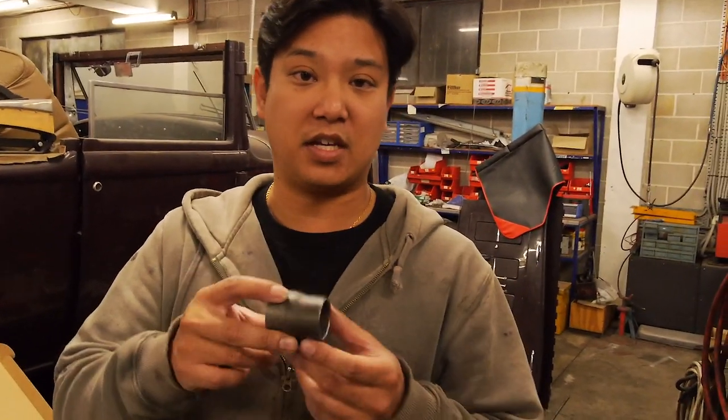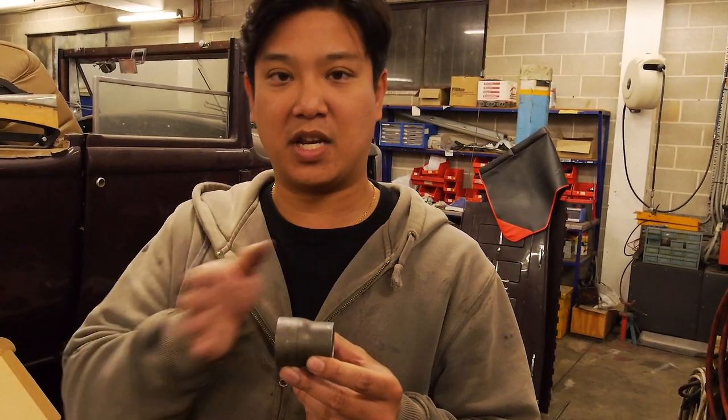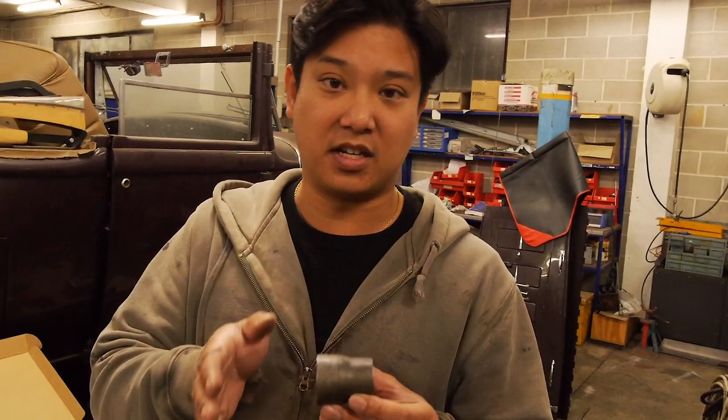Yeah. Whereas if you use one of these, you can't reef it up. So then in service, that bearing moves a little bit against the abutment that it wasn't sitting against when it's fully installed, and you lose preload. So that'll make sense a bit later when we look at the proper assembly.